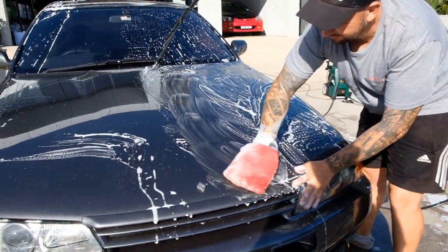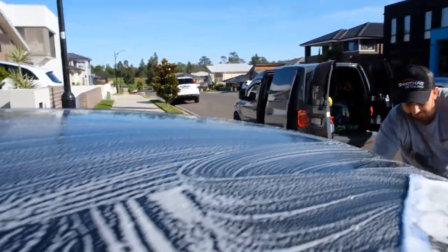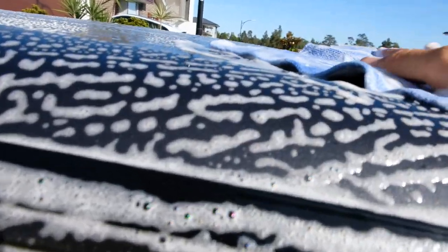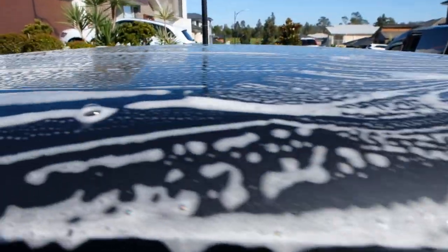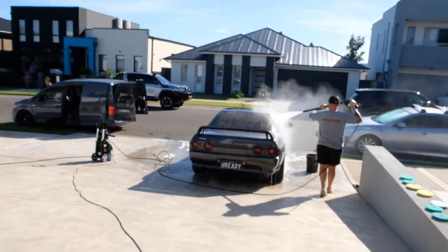Because you're essentially lifting the contamination. If it's tough paint, it may not mirror it. But you're lifting the contamination and it's sticking to the clay mitt. Now, regarding claying — if you're claying a car dry, not in the washing period where it's soapy and wet, you can just use a spray wax or a quick detailer as a lubricant between your clay mitt or clay bar and the paint, or else you will severely scratch it. That lubricant will help it slide.